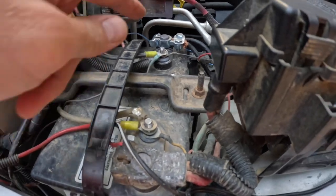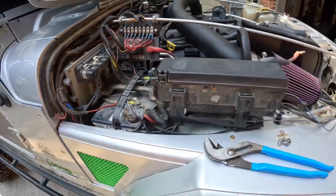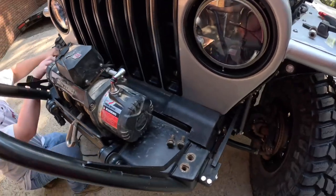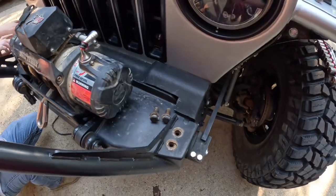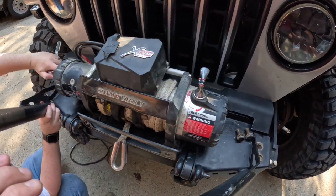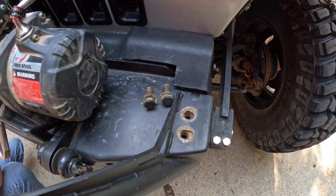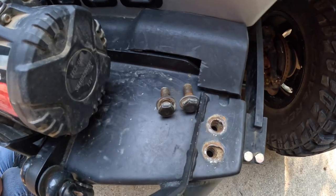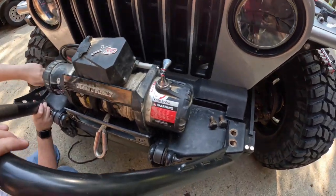We've got all the wires disconnected, left everything alone. This battery is pretty nice — it's got separate terminals for the positive and negative to run your accessories, so you don't have to pull the main terminals off. We fished all the wiring out and we're working on pulling the Motobilt bumper off now. We got the fairlead off and the Factor 55 unit off. Once the bumper comes off the winch will obviously come with it. These bolts are usually a T55 Torx — that's what they were from the factory — but his were actually a 19mm standard six-point bolt head.